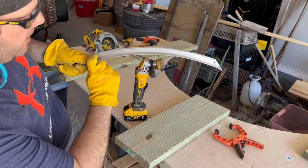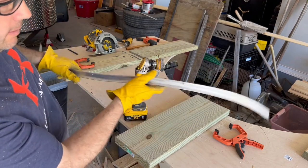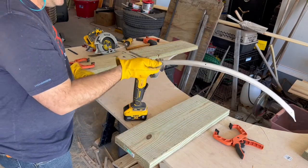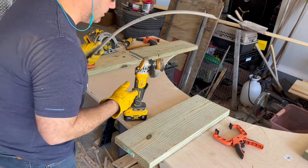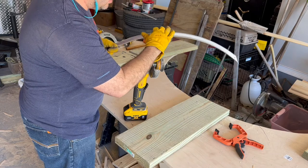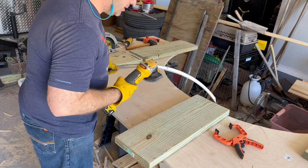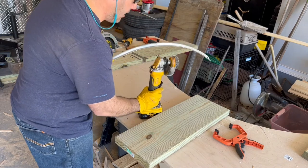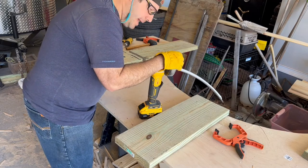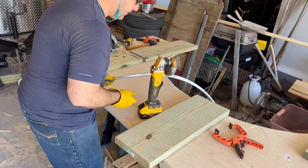Shiny finish on here. All right, as opposed to what it looked like before. So you keep doing that, you do it on the inside, on all your surfaces, and then you can put it on the trailer. This is how you redo and reuse some of this trim. You can do it for any of the trim on the trailer. You just put a brush finish on it, is what I call it. What that is, is using this cup brush to actually brush the aluminum to where it's a nice bright finish.